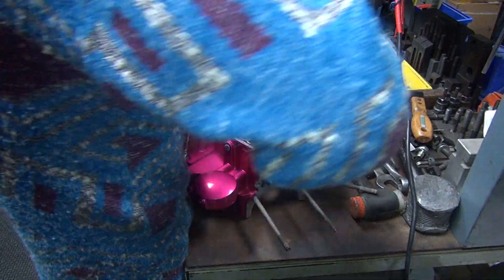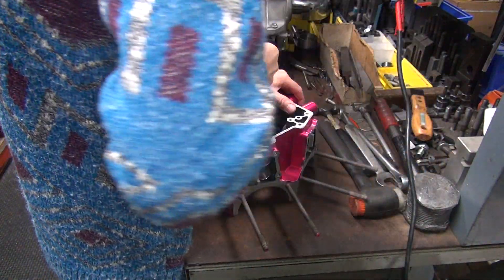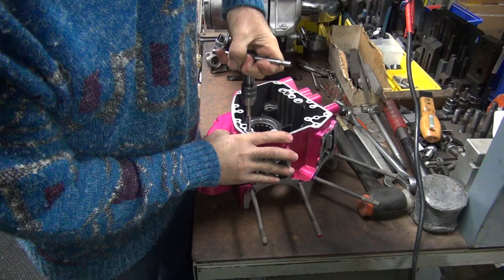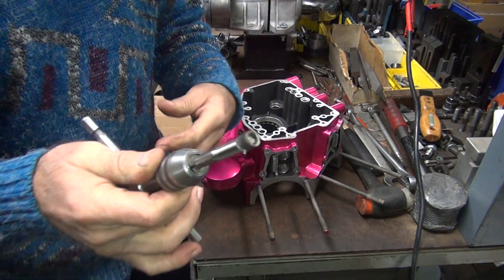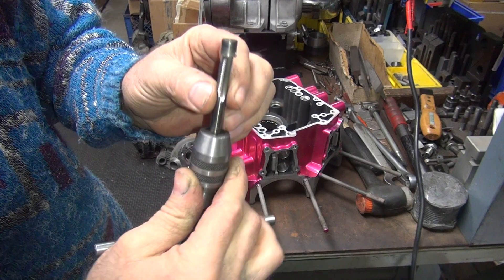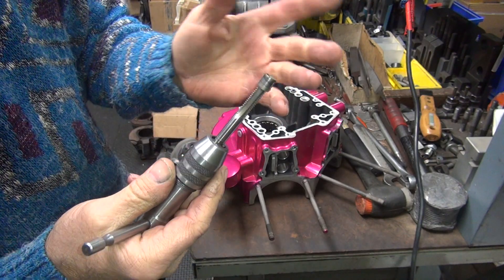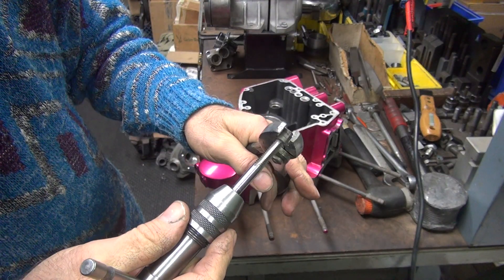This one does not want to come out. There it goes - now the bushing is turning in the case and you're pulling up on the T-handle as you're doing it. These things are in there good. See how far I had tapped into it? So now it's out. You can see I'm at a little bit of an angle, so that makes it dig in pretty good. That's why you're sacrificing these. Now you take a pair of vice grips or pliers with a rounded end - it helps. This one is probably not going to want to come out very easy.